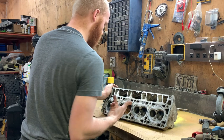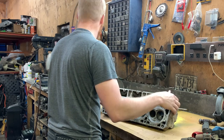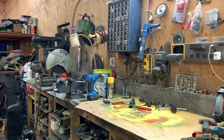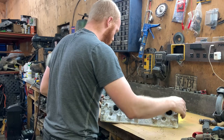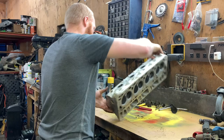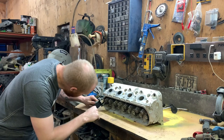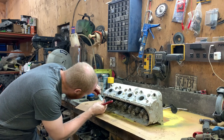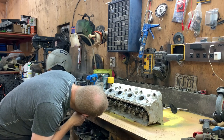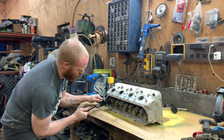When I was young, I always wanted to buy an extrude hone machine. What's that for? Extrude hone has a mixture of fluid and sand. They pump it through the port at really high speed and high pressure. Oh, so it's like a sandblaster. It basically polishes the port and reshapes it with an abrasive sand. And because water travels the same as air, in a sense, it makes it the most aerodynamic, with the most port volume and all that. Nice. But it's like 50, 60,000.